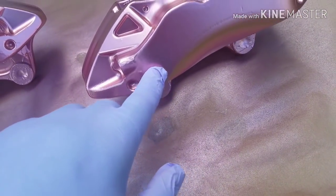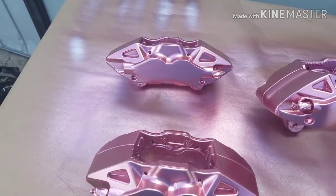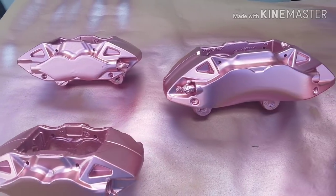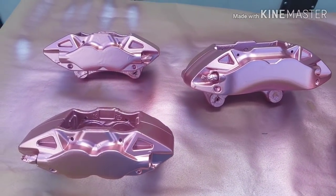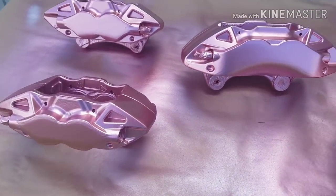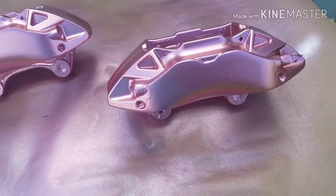But anyway, I think once I bury this heavy clear on there, this Tamco high impact, 50% solid contents, no, 55, I think it's 55 on the impact. The impact is a high solid. No, it might be 60. I know it's a higher solid than the other clear. The other clear is 54%. But even with the 54%, once I smash that on nice and wet and creamy, should bury it, won't be noticeable.